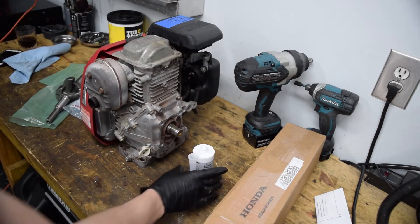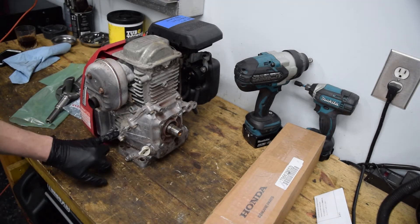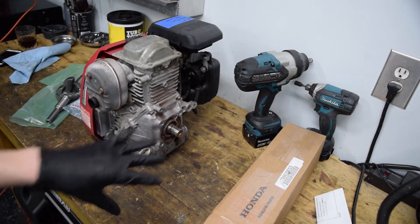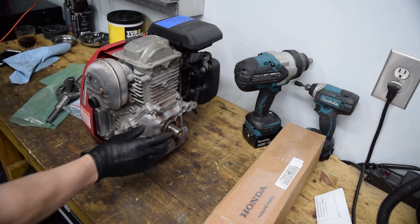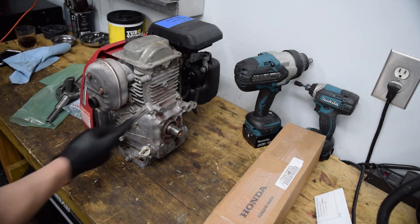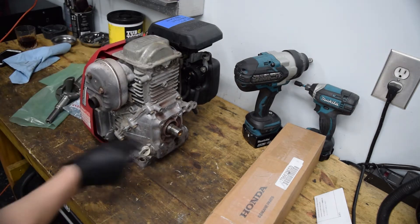The case is split on the side here, and also the valve cover — both of which are sealed just with RTV. There are no gaskets for them, unlike Predators and Briggs. There's no side plate you can just take off; it splits diagonally down the side and all the guts will stay with one half.